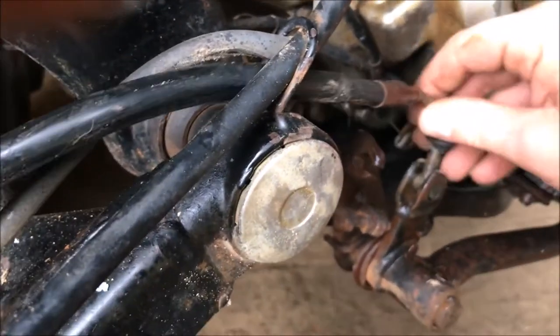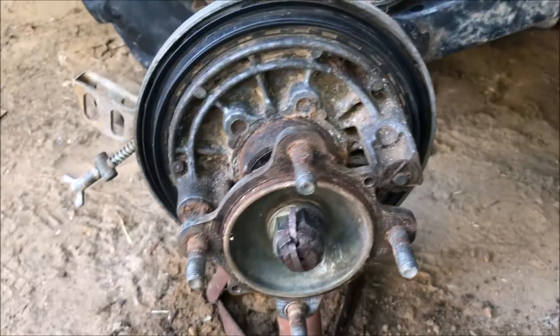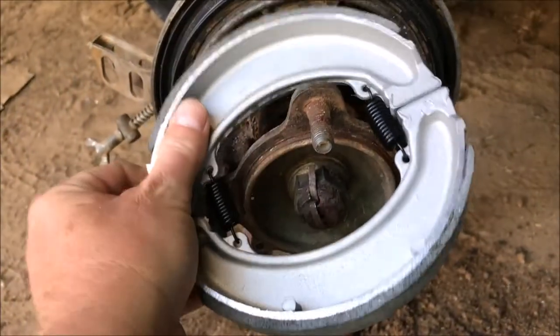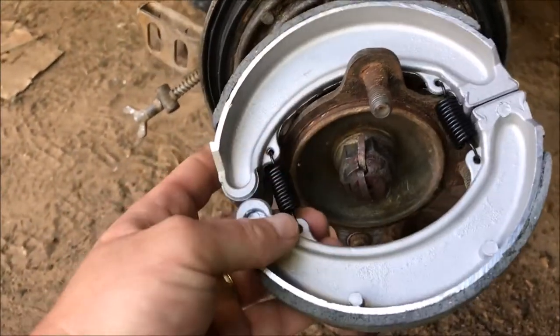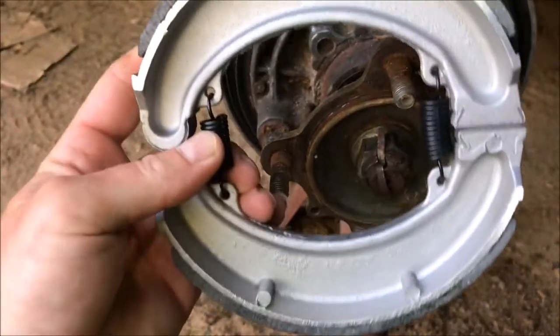You can simply slide that up and slide it on out, removing it from right here. Rotate it forward and push it that way — I don't want to have to take this axle part out. You're gonna notice the brake pads are not gonna fit over that, so I'm going to take one of these springs out and then put the spring back on.